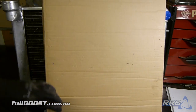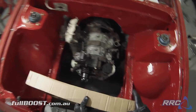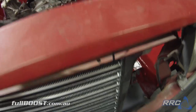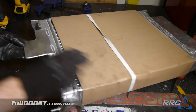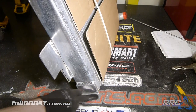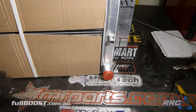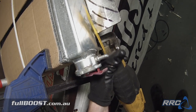Temporarily to mock it up, we're using the cardboard box that the intercooler came in — it's a little bigger than the radiator will be, but it works effectively for getting the dimensions we want. We'll push this into position — it's a bit tight on this corner — and tape it down so it holds itself in place. This is the modified side and this is the standard side still. We've cut that section off, sanded off all the weld, sectioned off down the bottom, and cleared a little bit here. Now we just have to repeat the same thing on the other side and cut off this barb.